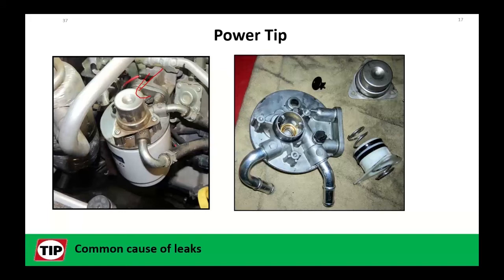Remember, I mentioned before, every pump that comes back, whether it's new or a return for warranty, goes through an autopsy, and we can tell exactly what happened simply from the look of what's in that pump. So do yourself the favor and sit there until your thumb turns blue. Then go in and attempt to start the engine, let it idle. You may have to come back and pump that thing up again, so just be aware of that. That's the cause of a lot of comebacks on these things.